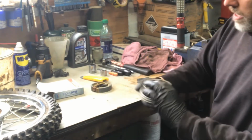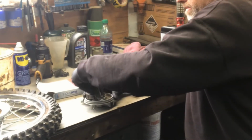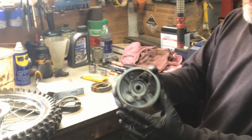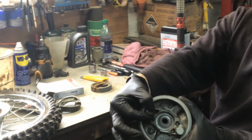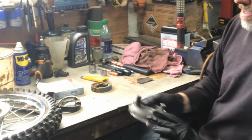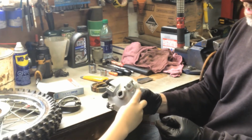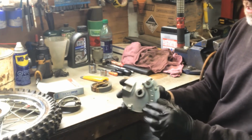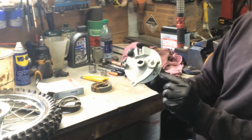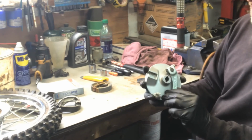So we just got to remove the old pads off of the brake assembly. You just basically pull them apart. Got to make sure that the cam where the shoe sits is free. You have to adjust this piece underneath so that it aligns with that. This here is a marker for when your brakes are finished. Once this arrow here aligns with this arrow here, that means your pads inside are completely shot. So it was really, really close.